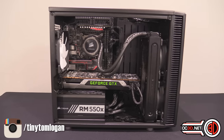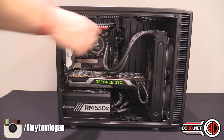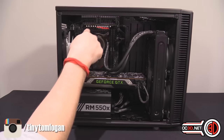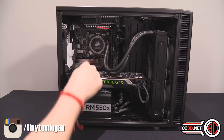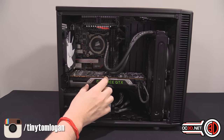But anyway, when we look on the inside, you can see the little riser card that I was talking about with the impact there. And there really is so little in it, it's unreal. Anyway, I did say I wanted to talk about that in the conclusion, so I should be quiet. So we've got the impact in there, and we do have the ITX board. It's 170mm by 170mm, a nice tidy little square. We do have the PCI Express connector right at the very bottom, standard, and then a dual slot card in.